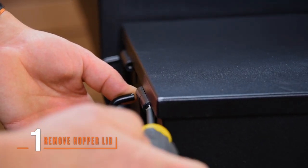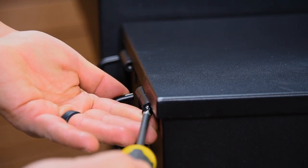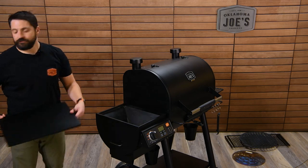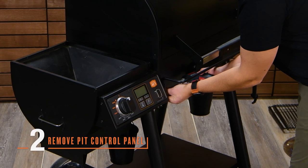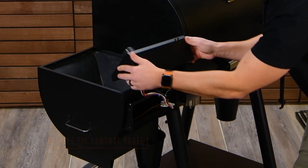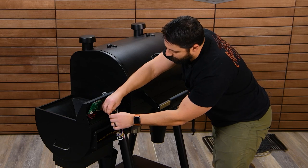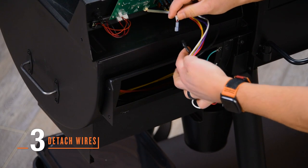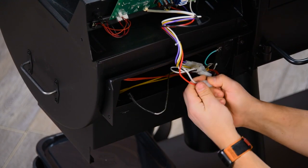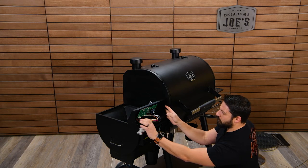The first step in removing the hopper housing is to remove the hopper lid. There are two Phillips screws holding the hinge pins in — unscrew those and remove the hinges, and the hopper lid will just lift off. Next, remove the control panel by unscrewing three screws — two on the outer side and one on the inside. With the screws out, remove the control panel and set it on top of the hopper, then disconnect the wires, making note of the colors. The small cable is your temp sensor for the smoke chamber. For the others, it's color to color: black and white to black and white, red to red, yellow to yellow, and the purple connects to the black.